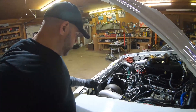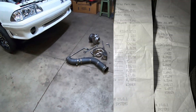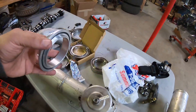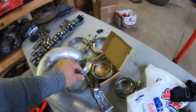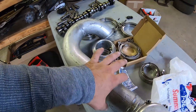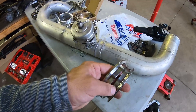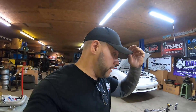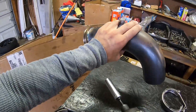Possibly run without a hood, which I really don't want to do. We've been anxious to find out if the bigger turbo would make a little more power and have a little more airflow, especially with the bigger turbo kit. Maybe we can get down to the track and get into the eights - we did run 5.80 at 119 with the smaller turbo. This is the end of the season and we're just here having a little bit of fun. We've got to get this aluminum V-band mounted - it used to be a slip fit but with it being a V-band now I'll need it welded in aluminum. We're going to cut the pipe by the intercooler and make a four inch to three and a half inch step-down adapter to see if the downpipe will fit without making another one.